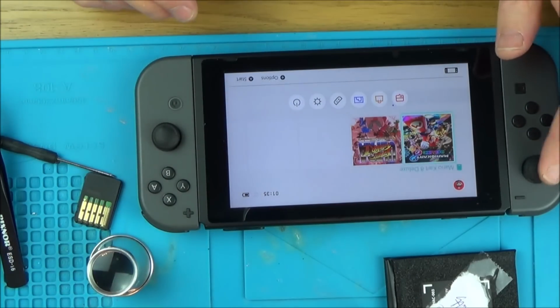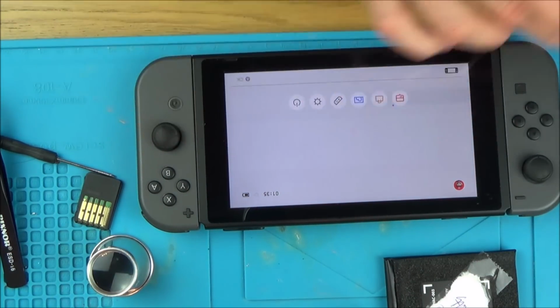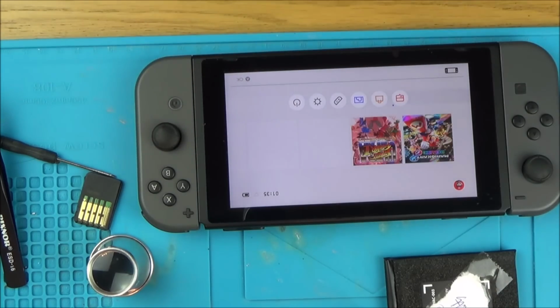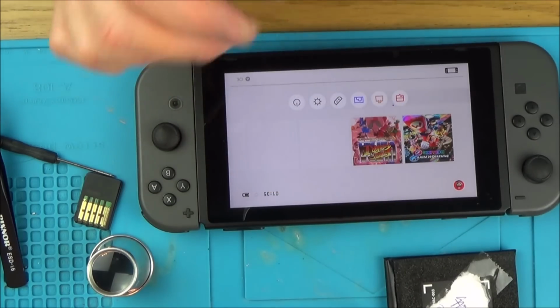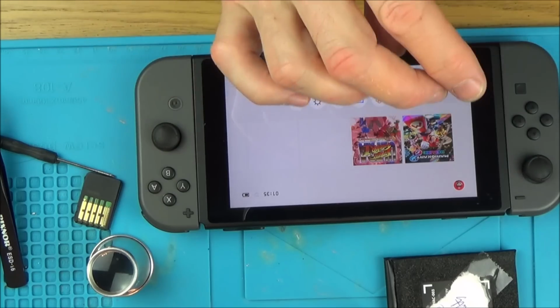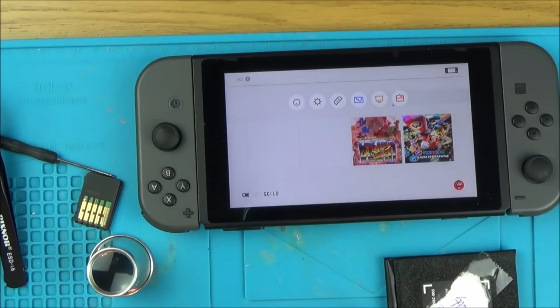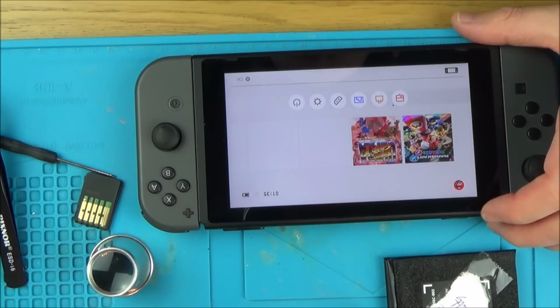But either way, I'm happy now that the switch is working, and for me it was an enjoyable one because it was something different. I definitely proved the fault with that capacitor, and every time I connected the screen, the capacitor shorted. Every time I took it away, it went. So obviously it was that screen connector there that was dragging it down to ground. So what a lovely, lovely fix. So let's bring this into a different room now and finish up on a little bit of gameplay.